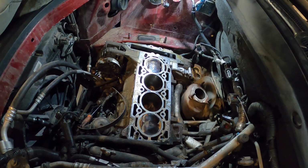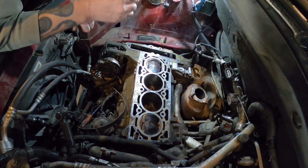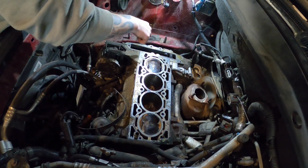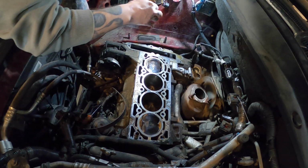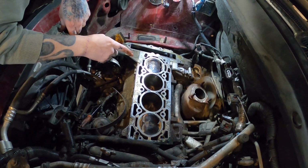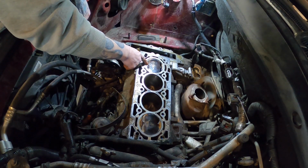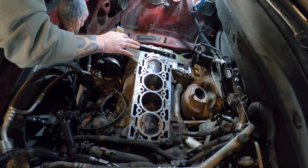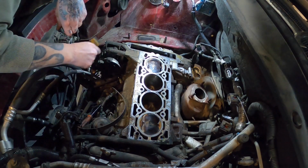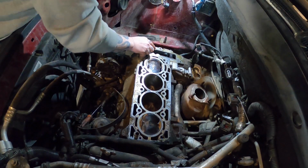All right, so our next step is going to be, I want to get the head put on it. So when we put the chain down in there for the main one, it can just go right down through the head and everything is all done. We don't have to worry about trying to hold the chain, put the head on, or anything like that. So we're going to get the block surface cleaned up here a little bit. We should be on top dead center for number 1 down there, so that should be good. If we have to move it just a tad bit, that's going to be fine. But it should be ready for the head to go down. We'll just clean this up a little bit and throw it on.